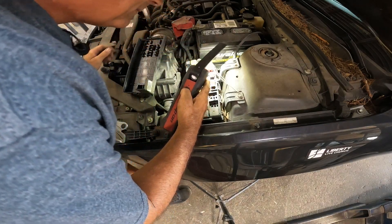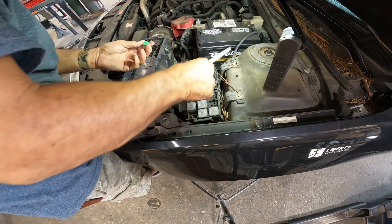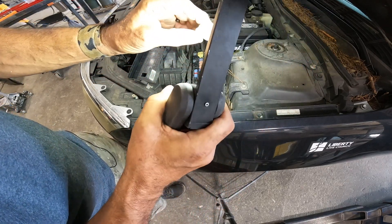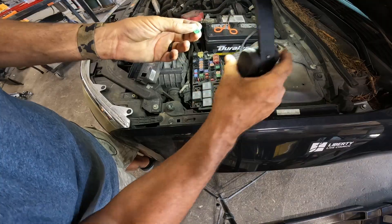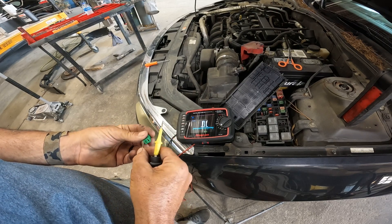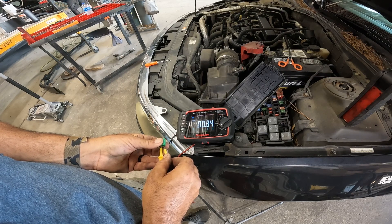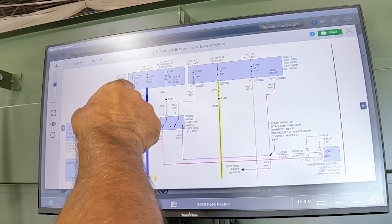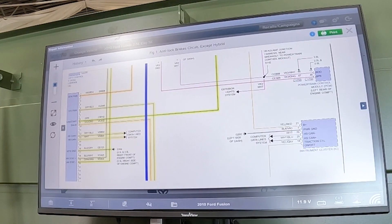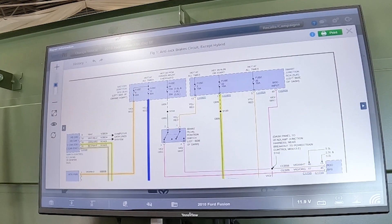It's kind of hard to see, let me pull it out. I'm going to ohm it out real quick — we are looking good. Nothing wrong with this fuse. We know fuse number 8 is good. Let's check number 10 next. That's the next one in line, and if you look it goes all the way down to the valve power. Let's go ahead and check that one out.